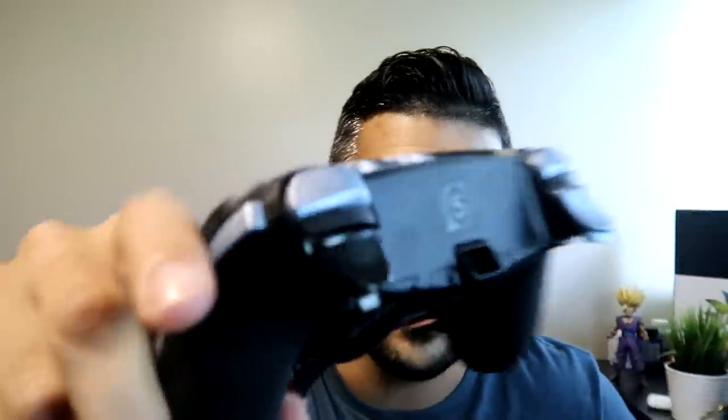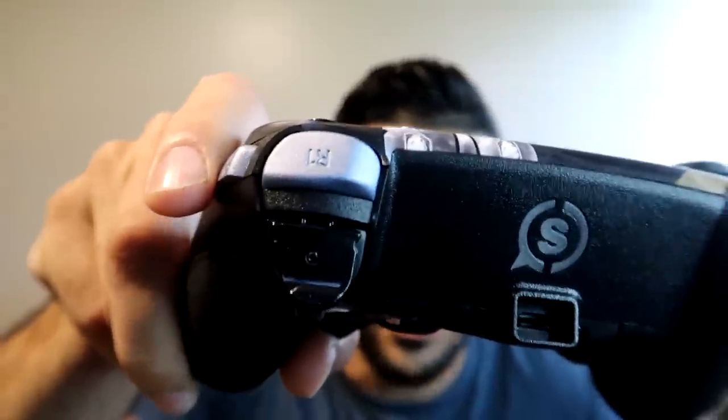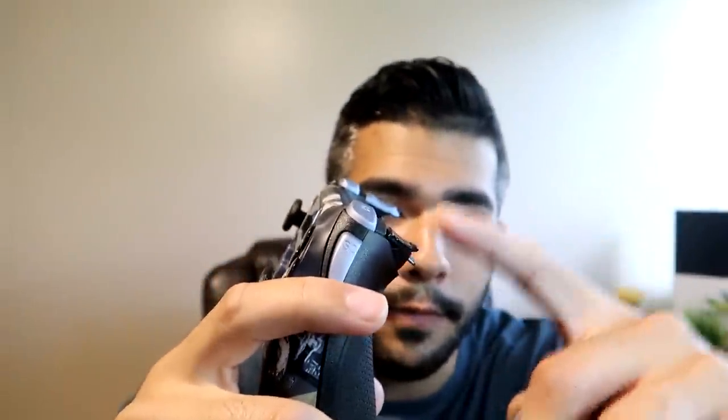The trigger stops are easily removable. Once removed, you can see the trigger screw and tighten it to make it even more sensitive — just a slight movement activates it. You have to be careful not to tighten it too much or it'll constantly click, so find the right amount through testing. You can put the cover back on and adjust all of this yourself, which is amazing.